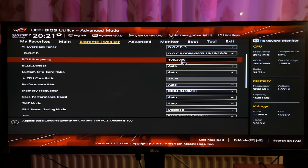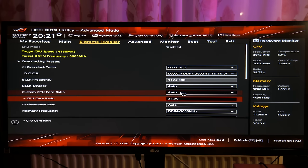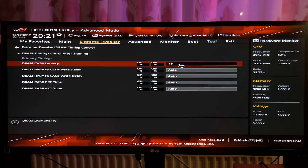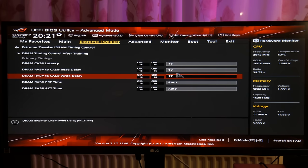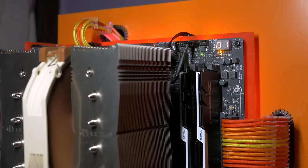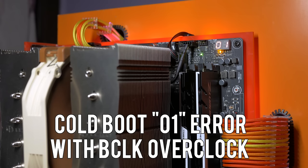Also I'd be careful of BCLK overclock and M.2 SSDs. SATA ports however — both governed directly by the Ryzen SoC and external PCH ones — seem to not be affected, but this needs further validation; I haven't had any problems with it though. Using this method you can get 3200MHz or even higher. I'd recommend using looser timings and then tightening them like in the previous step. This has a much higher chance of sticking through a reboot or cold boot, but in the off chance that it doesn't stick, like you see here, you can try tip number 4.